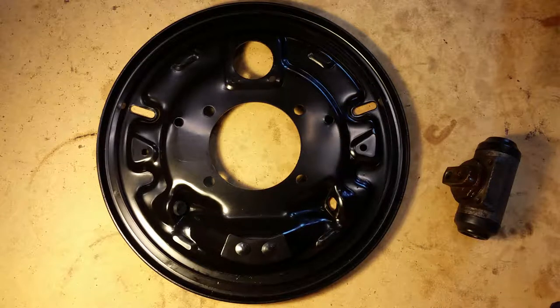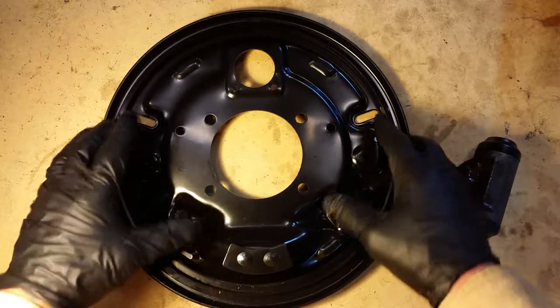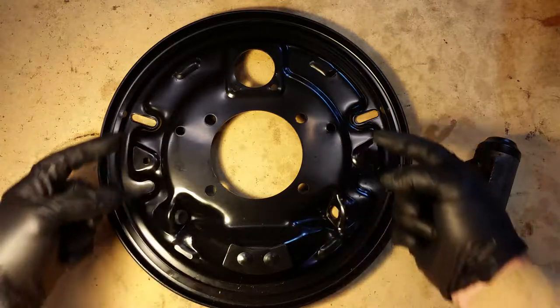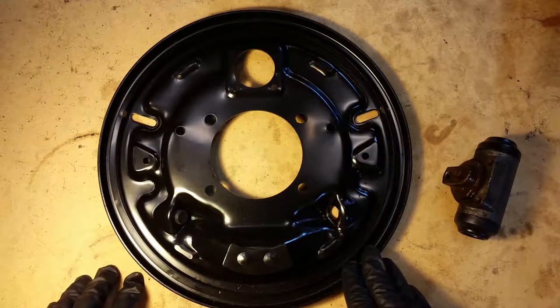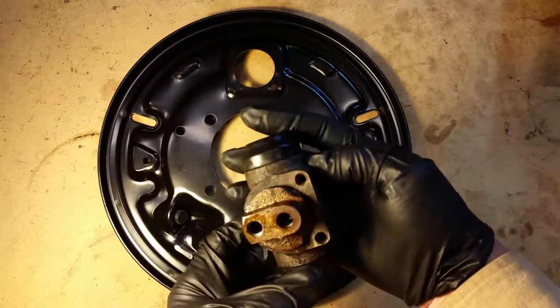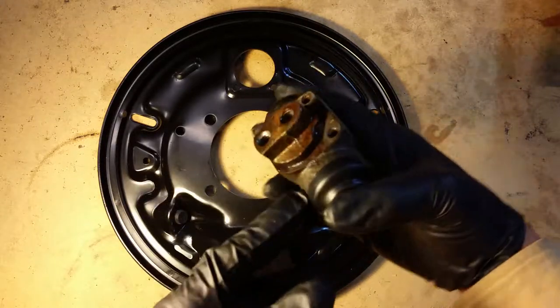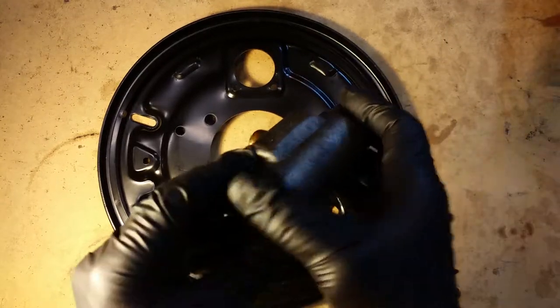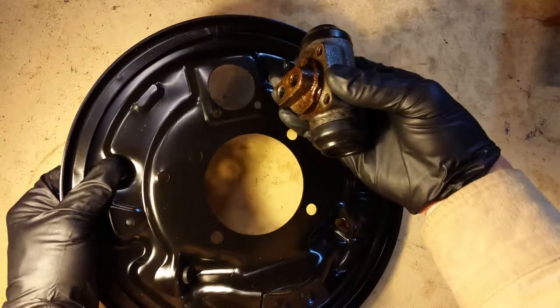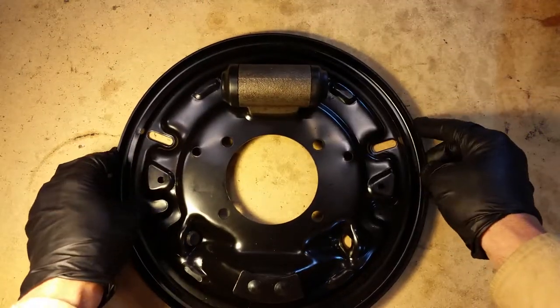But a couple of things you can check if your drum brakes are just not working well and nothing seems to be working right. Here is what your backing plate looks like — this is on the back side of where all of your springs and shoes would be, going across in all directions. Also, this is the piston, or the wheel cylinder it's called. Comparing this to disc brakes, the caliper has a piston in it that's pushed by hydraulic fluid, which goes into this port here. And it bolts right here to the backing plate.